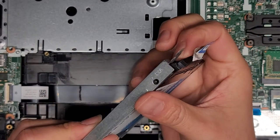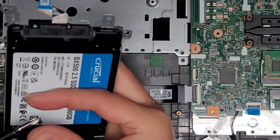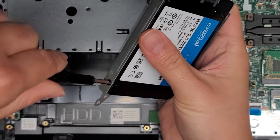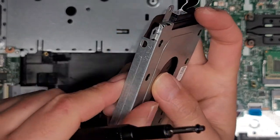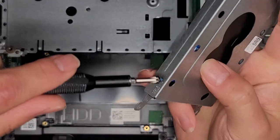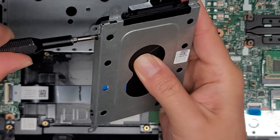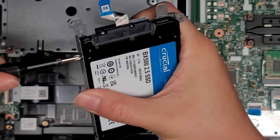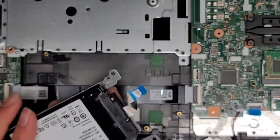The SSD is a little bit thinner, so you have to hold it up so that the screws align properly. I'll usually loosely fit the screws first so I can get all four in at the same time. This screw isn't lining up because the SSD is a bit thinner — the original drive is about 9mm or 9.5mm, while the new SSDs are 7mm.